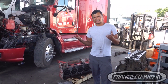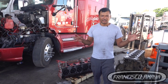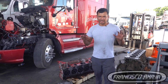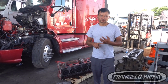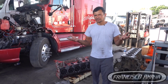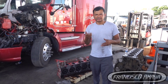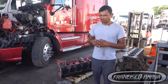Still, the engine had a problem — some kind of broken component. But the engine sounded fine; it didn't have any hissing sounds or anything like that, which means internally it was fine. My first assumption was the head gasket, since we only had coolant consumption and high pressure. As soon as you started the engine, pressure was being released immediately, and the most common cause of that is a broken cylinder head gasket.